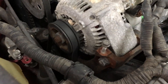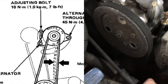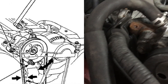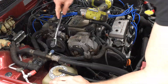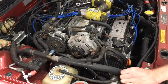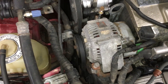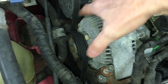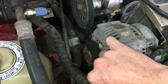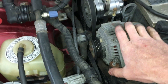It's time to remove the alternator and power steering pump. There's a bolt here on the pivot point and an adjusting nut underneath that you can't see — one for the steering pump and another right here. First loosen the pivot bolts, then loosen the adjusting bolt behind the alternator. Now the belt tension is loose and I can rotate the alternator. Let's get the belt off the pulley and out of the way.